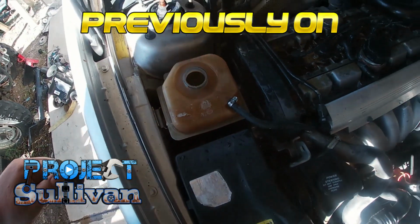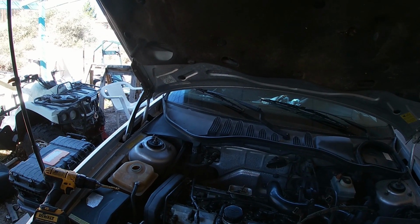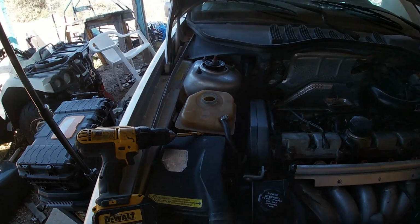We filled it up. Yeah, we did. And now it's empty. Well, I think the only way to figure out where it's leaking from is to fill it back up. You might be right. It might be the heater core, because on the inside, it's still not getting wet at all. We need to get a pair of vice grips to see if we can take that out now.